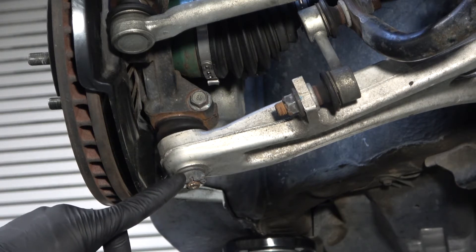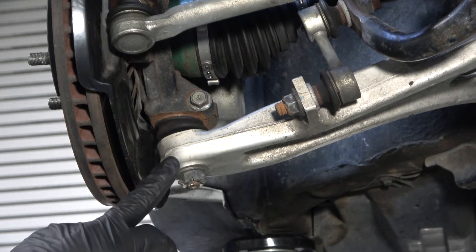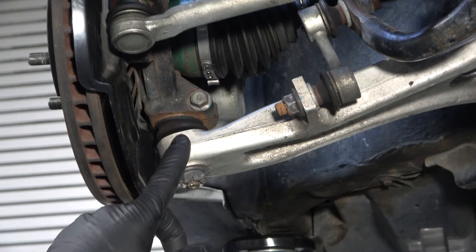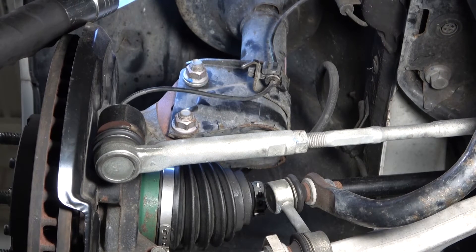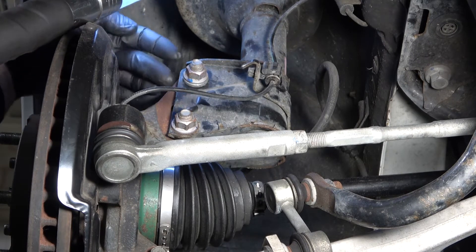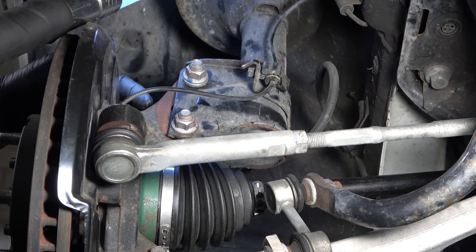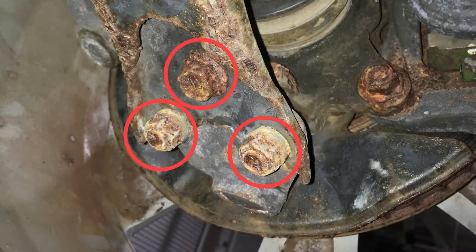There's a castle nut for the ball joint that can be removed and the ball joint could be separated at the lower control arm. There's a pinch nut that holds the ball joint to the steering knuckle. And finally, there are two bolts and nuts that hold the strut tower to the steering knuckle — I prefer not to take it off there because it has a greater effect on wheel alignment. So we will be choosing one of the ball joint options. This picture does not belong to the Subaru, but it illustrates other designs. There are three bolts that hold the lower ball joint to the lower control arm, which would also be an excellent place to separate the ball joint from the steering knuckle on this particular vehicle.